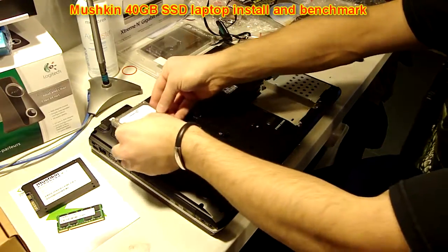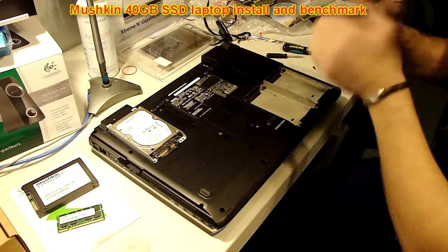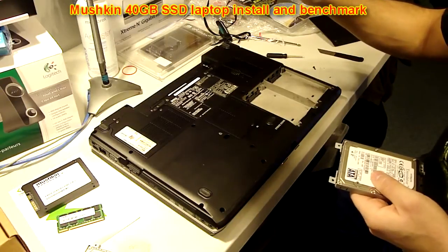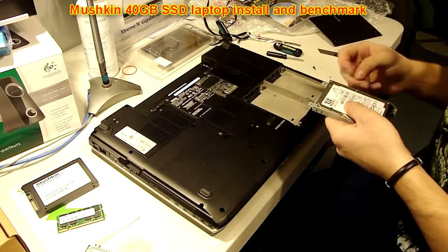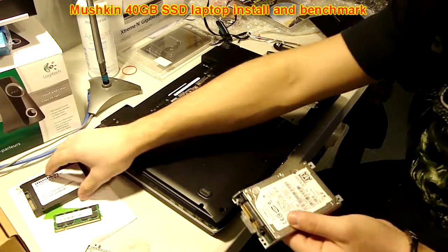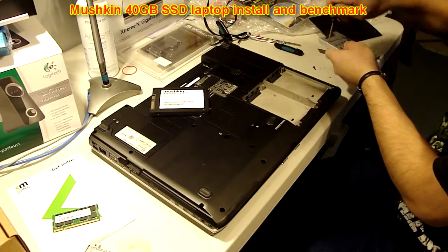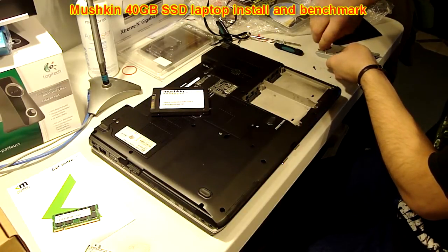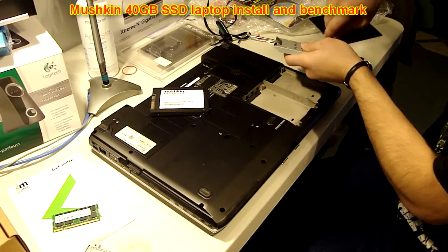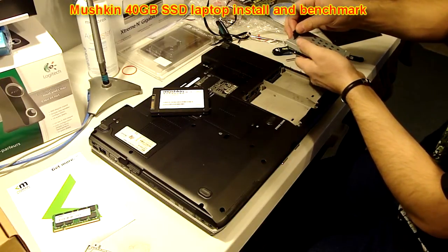This is our storage drive — the 500GB storage drive. And this will be our OS drive. I've already backed up all my data onto my brand new Corsair 16GB Voyager. Extremely fast, love it already. We've got to take some screws out of our caddy that are holding our drive. Normally it'll be four, but I didn't have extra screws for the second drive, so I split them between both drives.